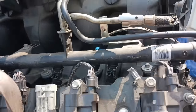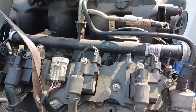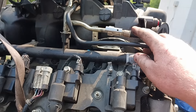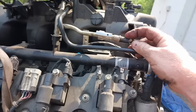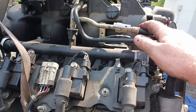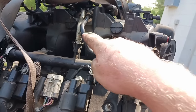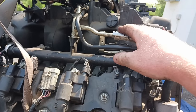There are two types of fuel rails that came on these trucks: the returnless, which is this one, and the return style, which has two lines going to it. With the returnless you pretty much always have to use the Corvette-style filter pressure regulator to bypass pressure back to the tank without using the rail. The advantage to the returnless is you only have to run one line from the Corvette filter up to it. The disadvantage is in a high horsepower application sitting still for a while, your fuel is going to heat up in the rails and lines. With the return style you have a constant flow going back to the tank, keeping it cooler. I like the returnless, so that's usually what I grab if one's available.